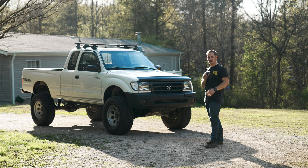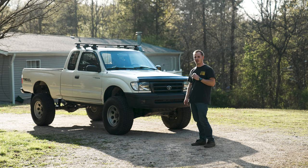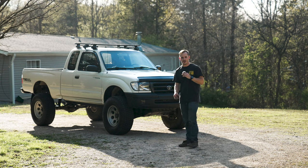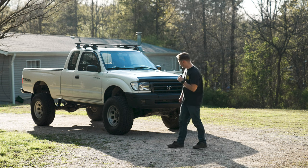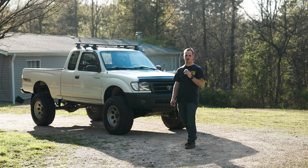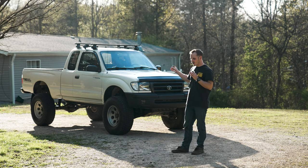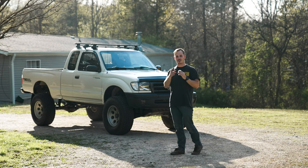Most of the day is gone now. I spent it taking out the overload leaves on the Tacoma. We got the camper shell off, the whole camper build taken out. Then I also spent the second half of the day taking out the overload leaf springs out of the leaf pack, which dropped it — I'm going to say at least an inch. The size of the leaf that I took out was about three quarters of an inch to an inch, so that's about what I should have gotten, although it looks like it dropped more than that. I feel comfortable driving this truck around without looking so much like a clown — it doesn't look as much like a drag truck anymore. I've dragged this video out over weeks, so I apologize for the lack of uploads, but I'm going to show you guys in the next video the upcoming plans for both vehicles. Thank you guys so much for sticking around. I love you guys, I really appreciate the support. I'll see you in the next one — keep elevating, adios my friends.